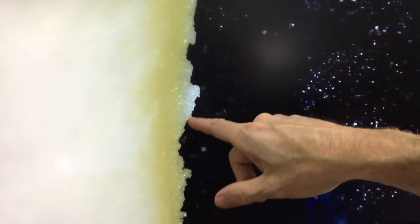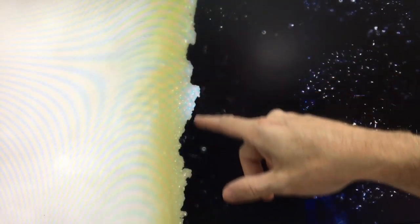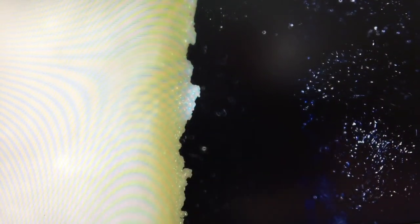As I focus in on the edge of one of these bars, you can see just how jagged and abrasive they are — and this is just a fine grade. We're going to switch over to a medium grade a little bit later. But now I'm going to take this clay bar over to the car, do a little bit of claying. You're going to need a little bit of lubrication — a dedicated clay lube or some soap and water — and we'll work on the bottom of the GLE 43, see what we can pull from it, bring it back to the microscope, and see what it captured.